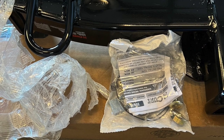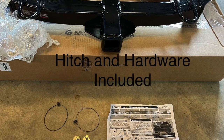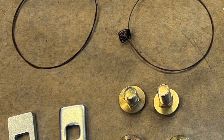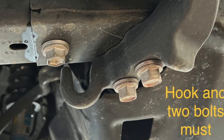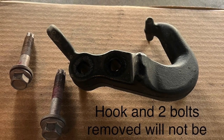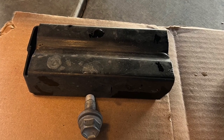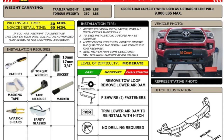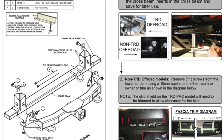It comes with all the hardware and all the parts to put this on. Review the instructions and you'll see it's got a couple of wires that you have to thread onto the bolts and also put those into the hitch to tighten it down. You'll be removing the one hook — it will not be installed again — but the end pieces to your bumper will get reinstalled after the hitch is installed. The instructions came in black and white, about five pages, and were a little blurry, but I was able to find them really clear on the internet. I included them in the description here along with some pictures so you can see them in color and get more detail.